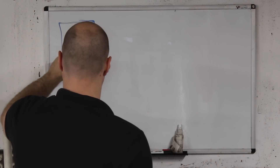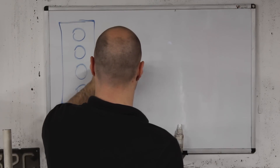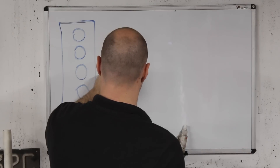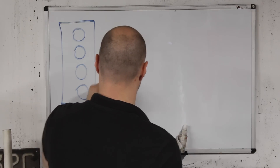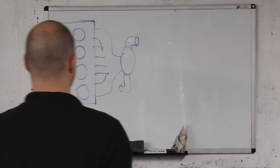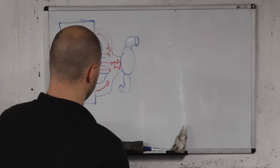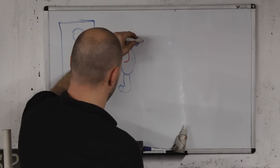There's a ton of information and theories around about exhaust performance, specifically back pressure and why it is or isn't a bad thing. My very simple understanding is that specifically in a turbo application it's a really bad thing, and in all cases it's a compromise and the drawbacks can be minimised. The ideal turbo back exhaust system would be none at all — it's all about getting exhaust gases out of the combustion chamber and maintaining volumetric efficiency. Exhaust gas leaves the cylinder under pressure and it's this pressure that drives the turbine before exiting through the exhaust system. The turbine itself creates back pressure as an object in the path of the flow, but we need this back pressure to make boost so we compromise.